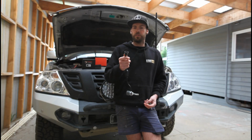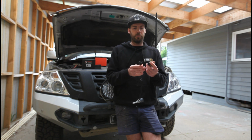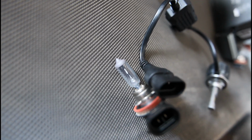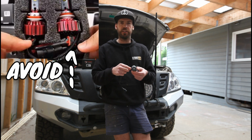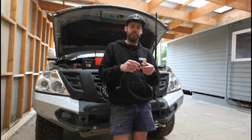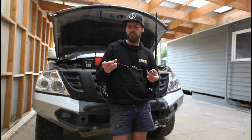The LED globes, if you get the right one specific to what you're swapping over, they come with the same plug, so they're basically just a plug and play unit. With the wiring too, you want to make sure there's no single insulated wires. If you look with this, all molded in, so there's no way wires can get damaged real easy from being singly insulated.